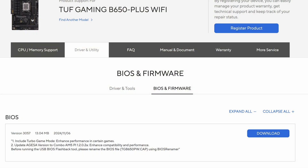What you need to do is go to your motherboard support and downloads page and find the BIOS section there. It's usually in the section where you can download drivers, and on the ASUS website it can look something like this. Just make sure it says 1.2.0.2A somewhere there, or perhaps a number higher than that if you're watching this video in the future having built a system with new AMD CPUs and you're having issues.